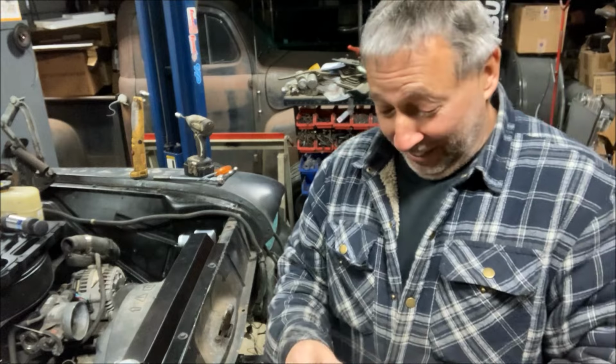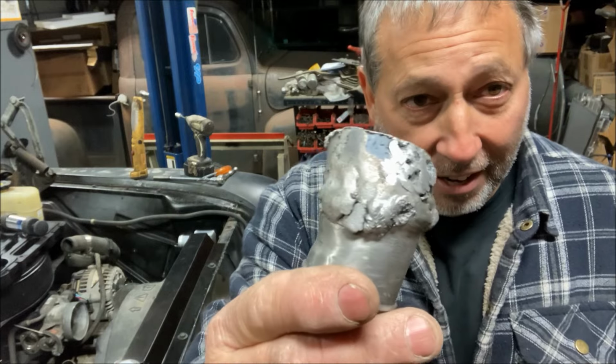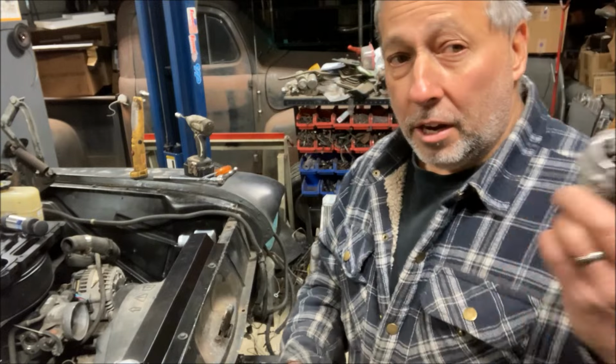Failure. I am not afraid to admit when I just cannot get something to work, and I cannot get this spool gun to work. I cannot get it to do what I want it to do. Where the heat setting has to be in order for it even to make a burn is so hot, it wants to blow right through, and as soon as I back it off, it's a cold weld, and I'm chasing stuff. You want to see ugly? That's ugly. That was just trying to build up material to try to seal this thing, and I'm just chasing a leak, and I'm like, you know, I'm just wasting my time here. Cut it off.